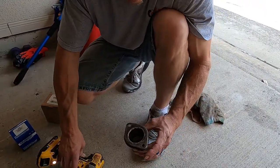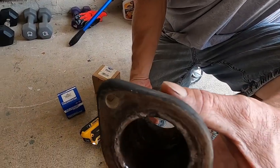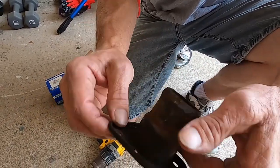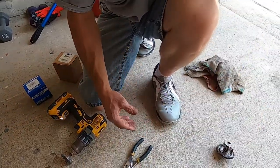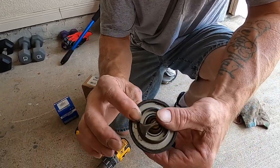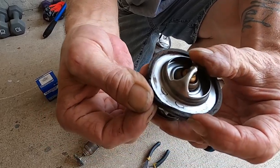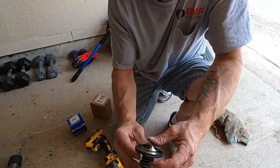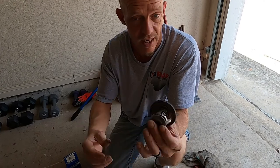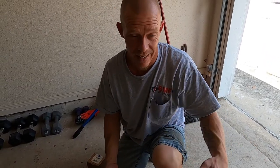It's as simple as that with a wire wheel. Before I even started cleaning it I could see the crack right there, so I knew at that point I needed a new one — but we went through the process anyway. This is trash — done deal. Now the thermostat itself looks good, but look at that o-ring: it's cracking. That's never going to hold water. You can keep the thermostat maybe to show how it works in boiling water, but for me it's out of here — it's trash.